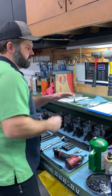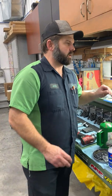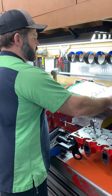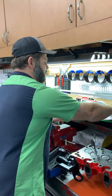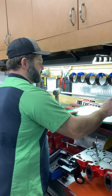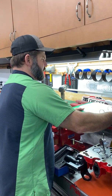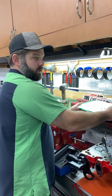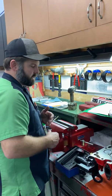Okay, so like I said, that's more for later use and for your own knowledge, but a lot of cam manufacturers, like Hamilton, we use Hamilton over Cummins builds, will give you this information. If you have no more than 25 thousandths piston protrusion and at least 55 thousandths valve face depth or valve recession, then a 188-220 or a 178-208 is a drop-in. So that's why it's important to check protrusion.